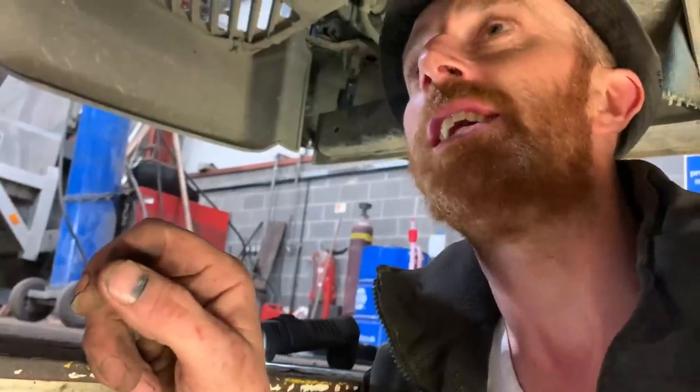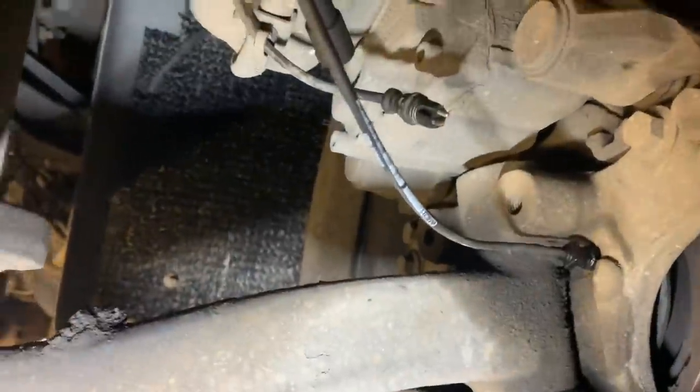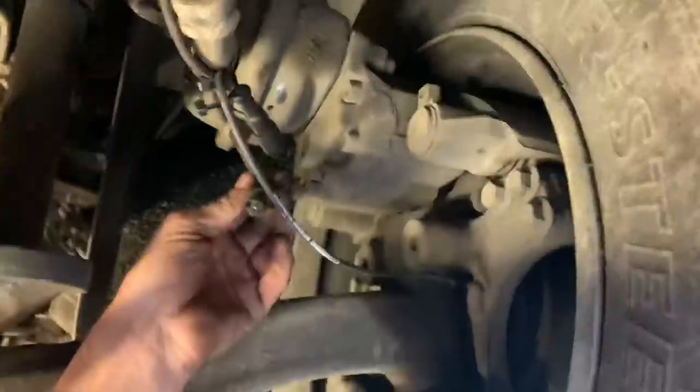It's been to Ford and Slater — at first they said it was the valves there, so the lads have fitted them down either side. And then obviously they've put new sensors in it. I've just rang up my ABS lad and he says to disconnect your sensor here and check for continuity, go from there and go under your grill. It looks as though there's been a bit of corrosion on.